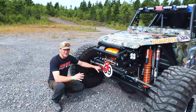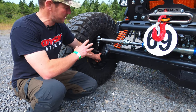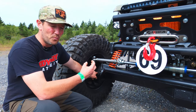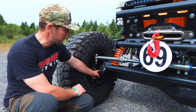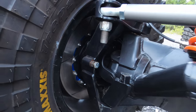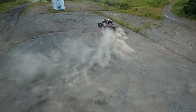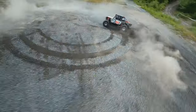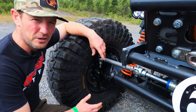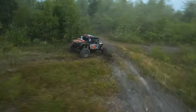These are the new Spider Trax Pro Series axles and they are absolute pure beef. Down here at the new joints — this has always been the weak link of the solid axle setup. Previously we were using Dana 60 style joints, either hard metal on hard metal or metal on bronze. Look at the size of these joints now — custom built in-house by Spider Trax, using needle rollers so we don't get the same problems as before. They've also borrowed technology from IFS: look at these outer knuckles with increased bearing heights at the top and bottom, so we can put more load on without that wheel flick associated with solid axle vehicles. We're now using a 45-spline outer, so we're not getting that twist or snap-off we experienced with 35- and 40-spline. These are going to change the landscape of solid axle vehicles forever.